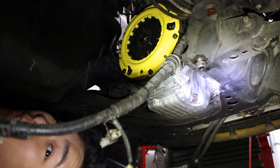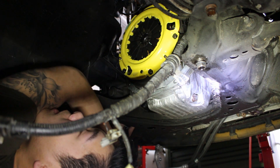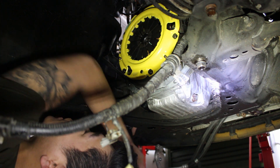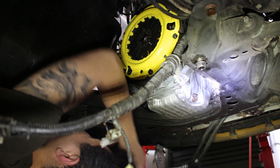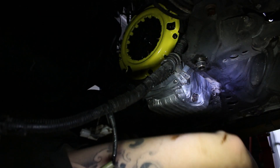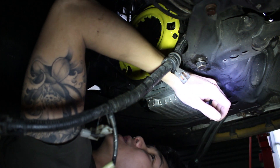I know this is not the prettiest angle but I'm putting the motor mount bolts on. They're both 14 millimeter and they're torqued to around 42 to 50 foot-pound. Okay, there we go — that's one. Now let's get the transmission in.